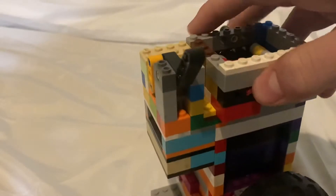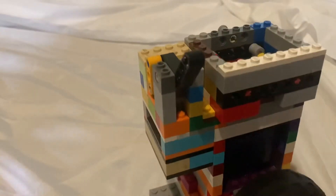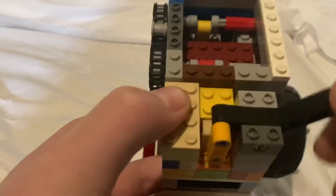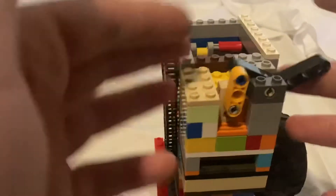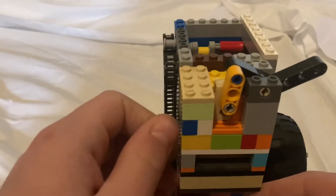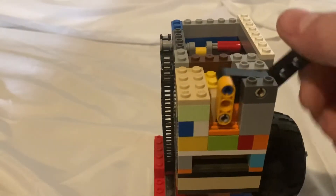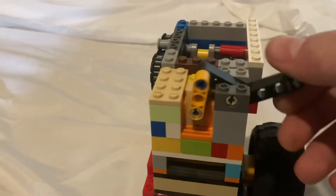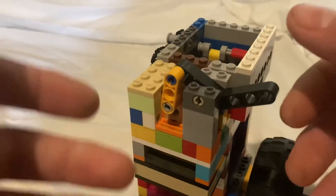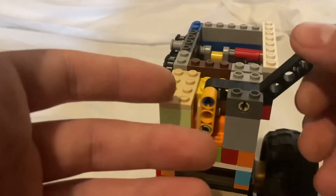Something that is different about this is that I have this slide throttle right here. This design is copied from Big Z18 because I'm actually new to making these kind of throttles. I usually make the tilt valve throttles with just the lever on the side, but I discovered that this is actually much better because you can actually adjust the idle, or the governor if you'd like to call it, so you can get it to idle at different speeds and still have the same revving opportunities.